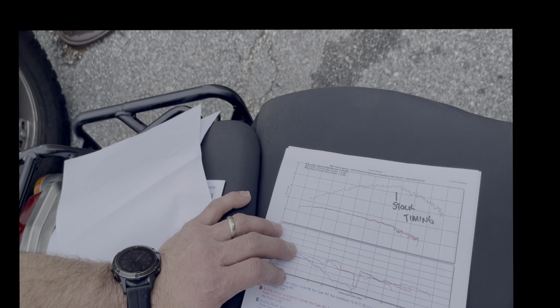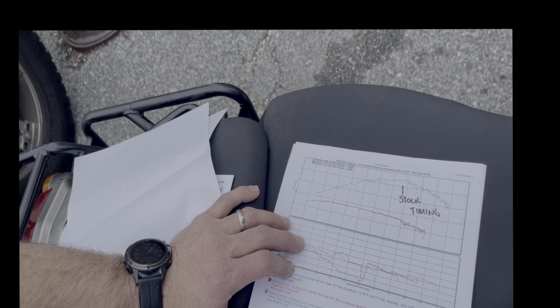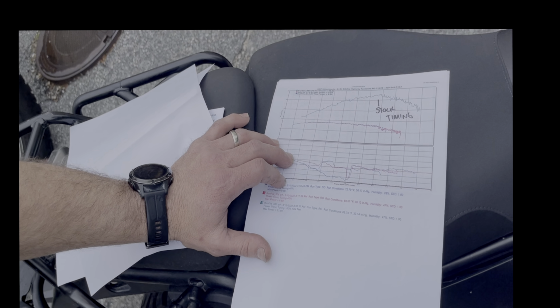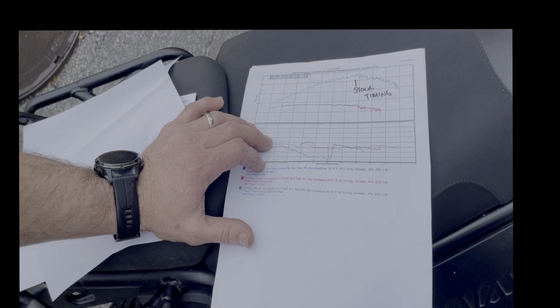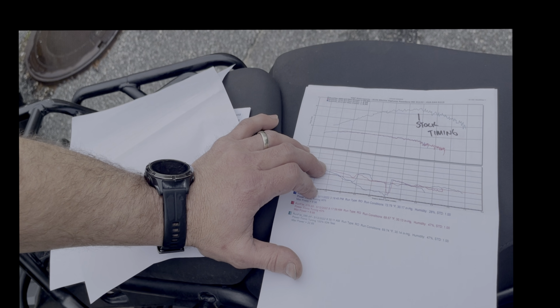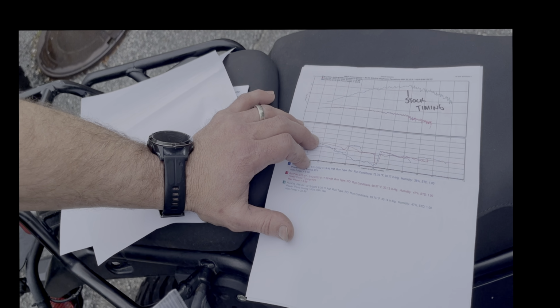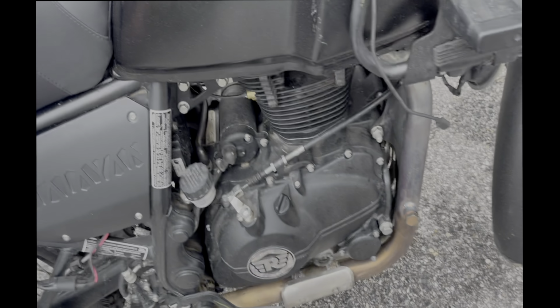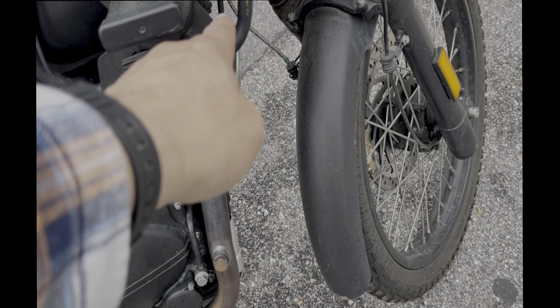How was the bike when it got on the dyno? Were there any strapping issues, or was it pretty easy to get on the dyno and set up? No, strapping was easy. The biggest thing with the stock exhaust was it's got chambers, so we couldn't use a sniffer on it, which is better than running an oxygen sensor directly in the exhaust. So we put that O2 bung in. Right, I did get a video of that. Now, did you take the old O2?